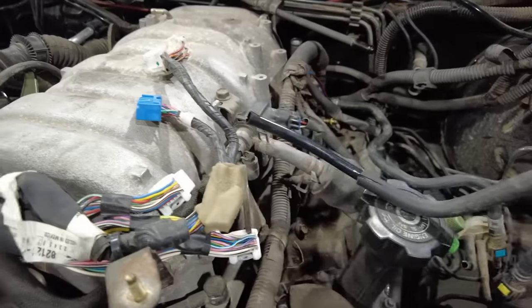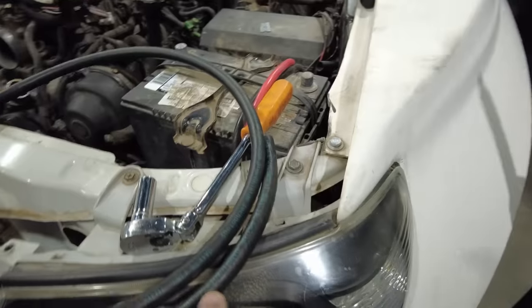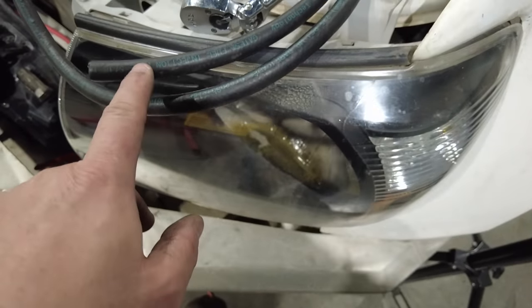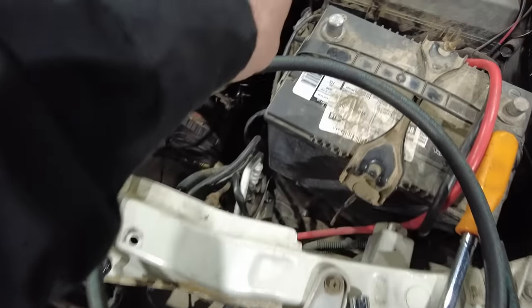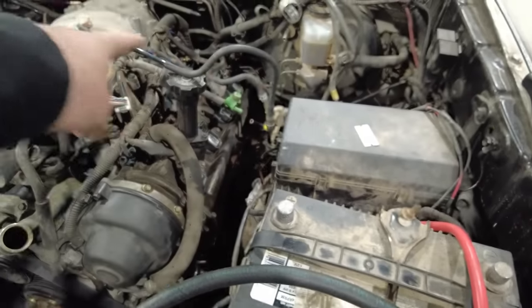And so instead of messing around with this and trying to get a tool, I'm going to go to plan B. I have this. This is actual 5/16 Gates fuel injection hose, rubber hose, and it's only a short little run. It's got to go basically from that quick connection right there over to there. And I have what are called permaclamps to work with this.